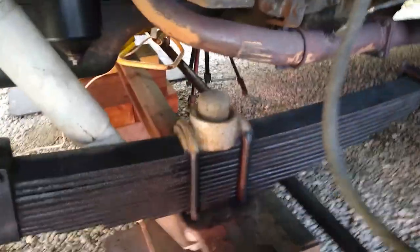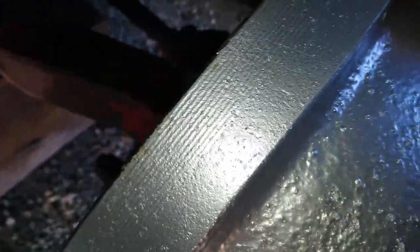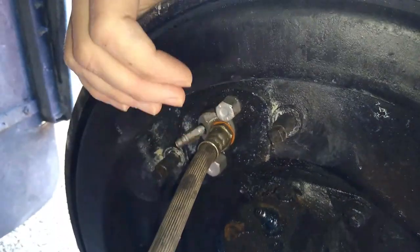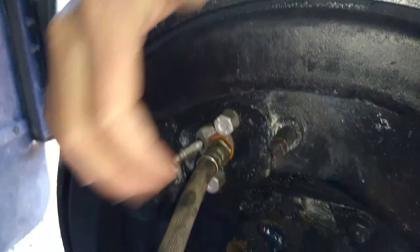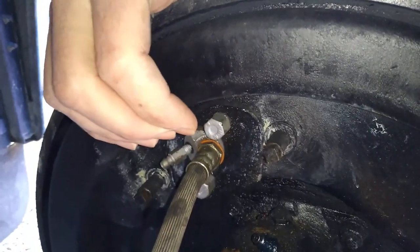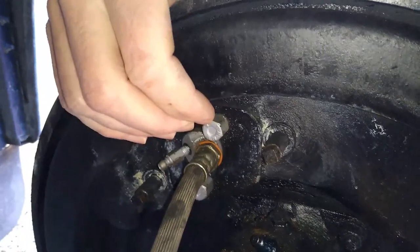And this is where we're at. We've got our hub back on. We've sorted our bearings out. We've got our wheel cylinder in and we are attached. We have no brake fluid in here. This hasn't been bled and the brake shoes have not been adjusted. While this work is for the front brakes, this assembly here is also common to the rear wheels on some Bedfords, so it will apply to that too.